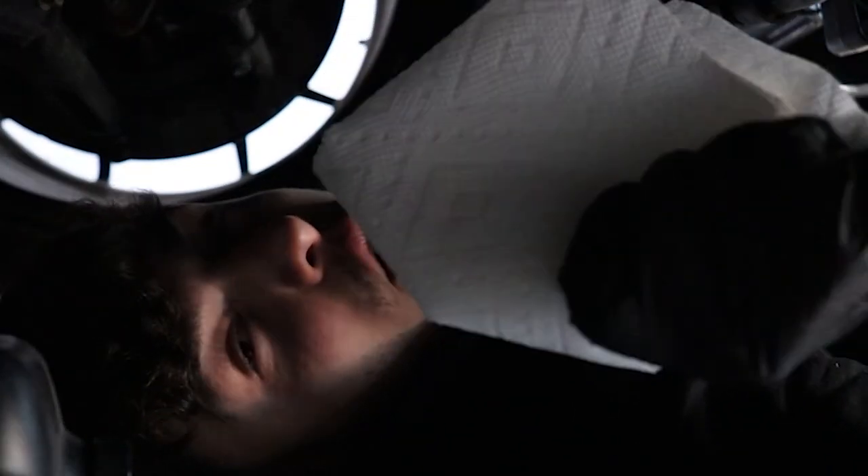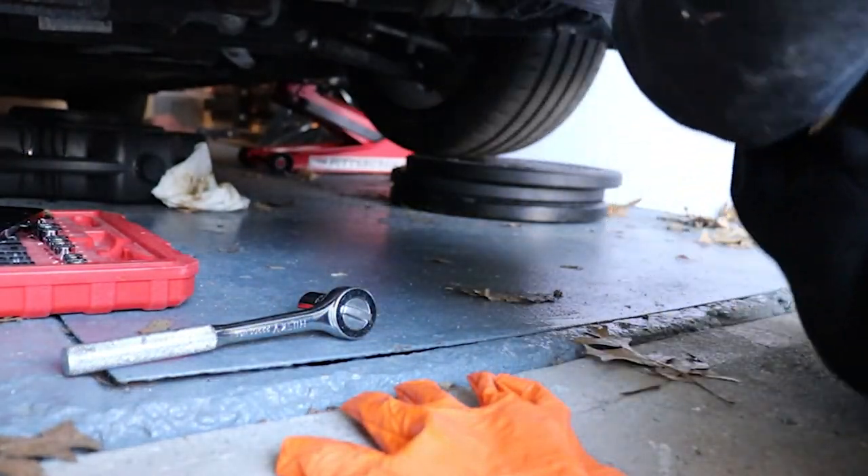We got the little washer in. Now we're getting the drain plug back in. I want to reiterate — be careful about the type of paper towels you use when wiping down around the bolt area; the fibers are too fine in regular paper towels and you run the risk of getting fibers in your oil, which would be very bad. Getting the bolt back in — you do not want to over-torque this; ideally use a torque wrench. I'm using a regular wrench until I can't really go anymore, I don't want to strip the bolt. Got it on snug and tight, leaving it at that.